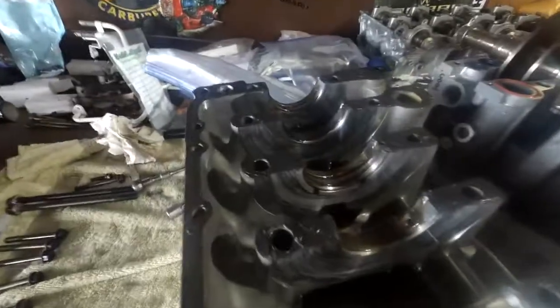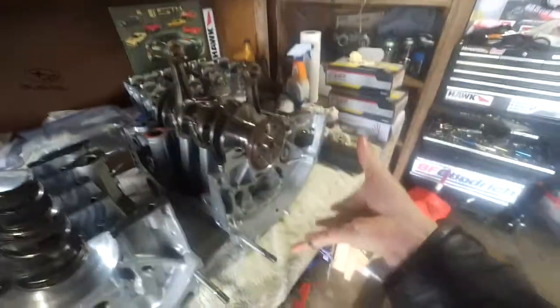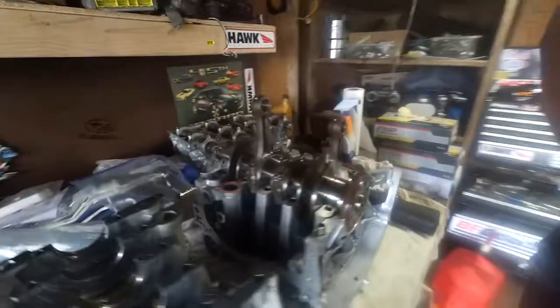So this is how I did the RTV — this is how I've seen other people do it. You just put a really thin layer and use your finger to cover everything, trying not to get it in the bearings. Then we're just going to pick up this whole half and put it on over that side. You don't want a lot of RTV because the clearance between the two block halves is really, really small — any extra RTV gets pushed out the side and you don't want it inside your block where it could get caught in a ring or a bearing. People have blown up motors that way. This is a nice, good amount — not too thick.